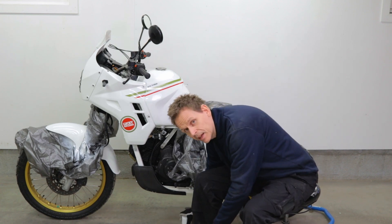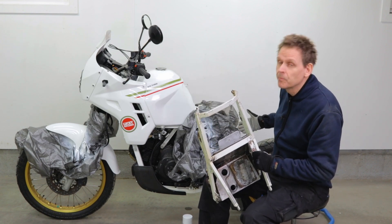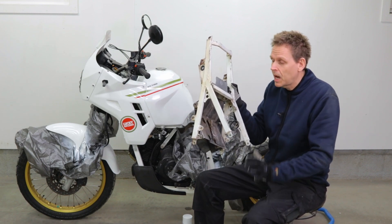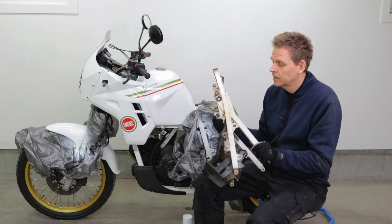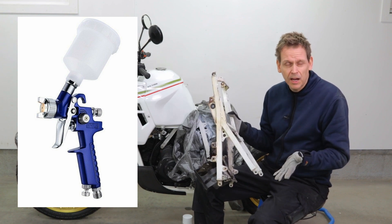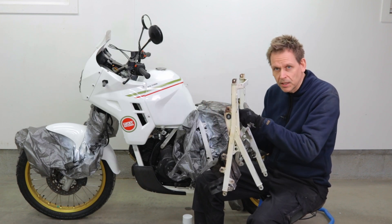I will not be using spray paint when I'm doing proper repairs or improvements to this bike, like I need to do with this subframe. It's really rusty and ugly. I took it off as part of a job that escalated - I was going to change the indicators, had to take off the fender, do some modifications, and then I saw how bad the subframe was. I think I will sandblast wherever it's rust, prime it using epoxy primer and proper 2K paint. I have bought a cheap paint gun from eBay, 20-25 dollars, a small one I will test for the first time.